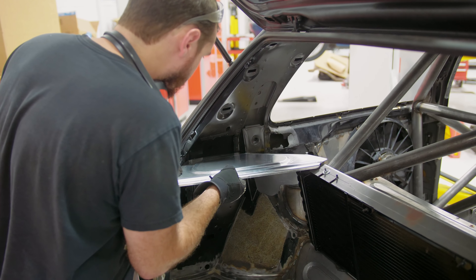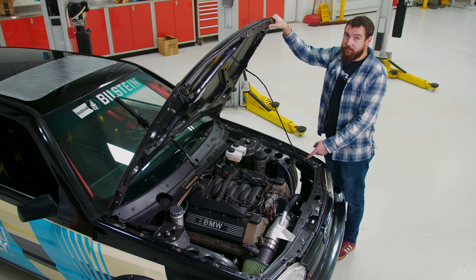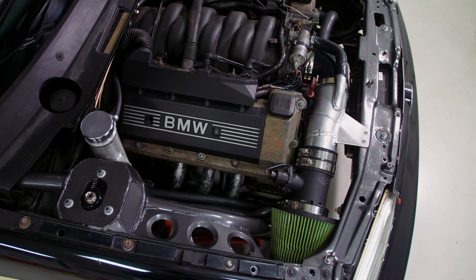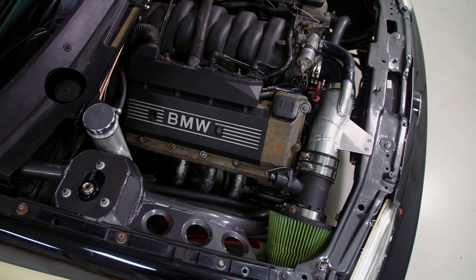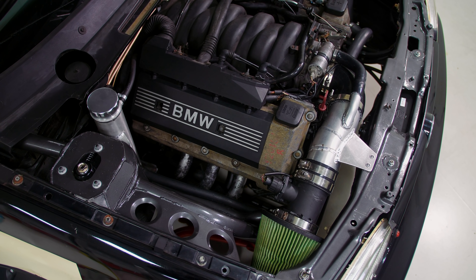Last time it was just sheet metal parts hung on it to get an idea of where things needed to be, but now I've finalized everything and mounted it. The front track width is so wide that I had to cut the fenders at the belt line and pull them out, as well as put flares on just to cover the tire. I got the factory bumper back on, but it's stretched over a bash bar so each side is about two inches wider — you can see the bash bar come through where the turn signals used to be.